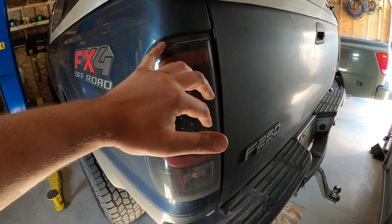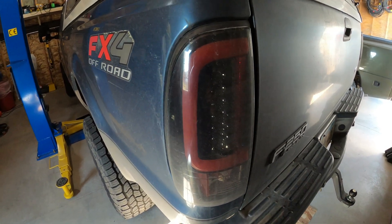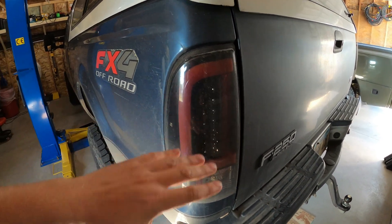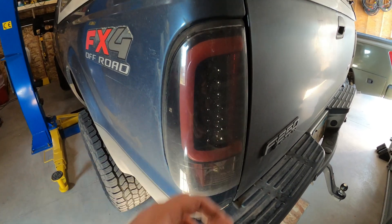But I do like to go play once in a while, so I want to take it from that location and get it higher — whether it's in the bed or, what I'll probably end up doing, is behind the tail light. I'm going to pop the tail light out and try to put the filter back behind there. It's pretty much in a dry spot, and I'm very rarely going to sink the truck below there, which means the filter will stay dry. That's what we're doing today, and all my parts are linked below.